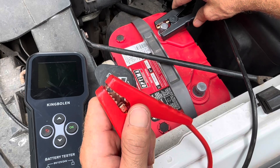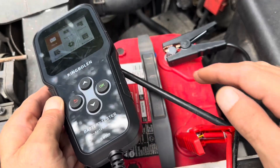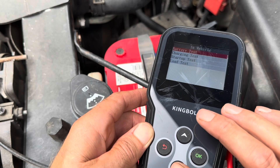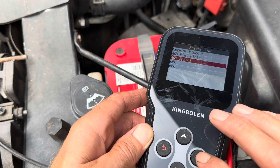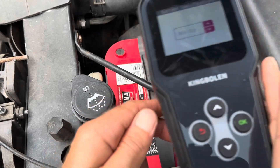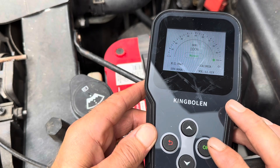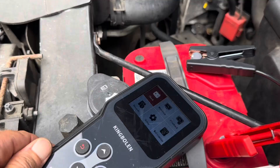This is where the unit really shines — this is mainly what it's catered for. It's a very similar consumer-grade setup to what you'd find at O'Reilly's or Advanced Auto Parts. Here's an Optima AGM spiral-cell battery. We'll do a 12-volt in-vehicle battery test, engine off — AGM spiral cell, cold cranking amps test, rated at 800 CCA. State of health: 100% normal, 12.01 volts, 2.98 milliohms — it's still putting out 862 rated cold cranking amps, above its rating.